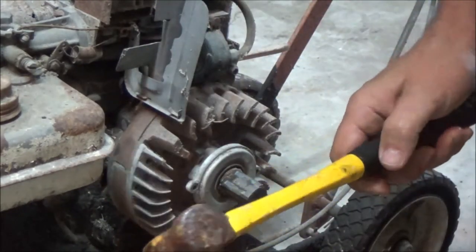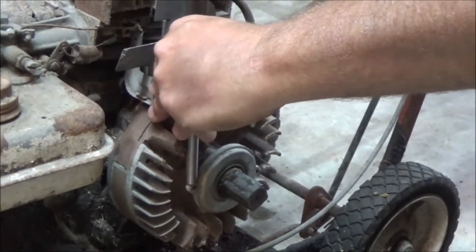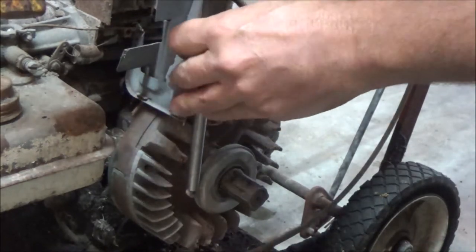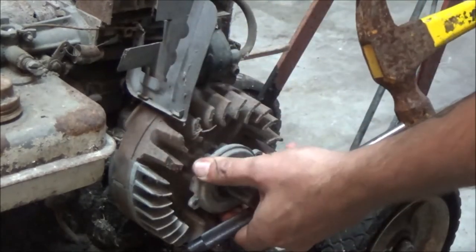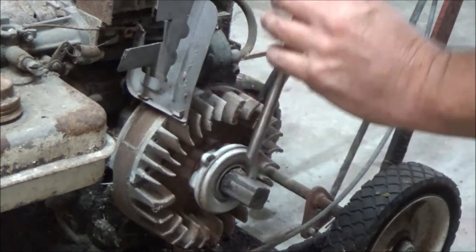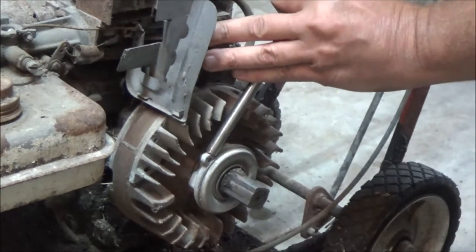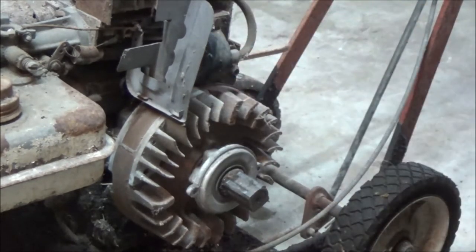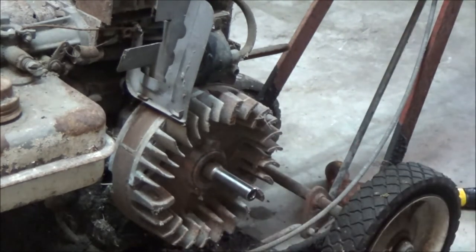I've got to use this hammer — it's not mine, I think I left mine in the back of Monkey's truck. Just take that and put it down here and give it a couple of whacks. Be careful not to break any of these fins off, because that'll knock the balance of the flywheel off and eventually you'll wear your bearings out. There we go — just like that, that's all you've got to do.